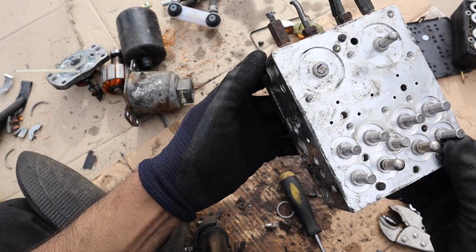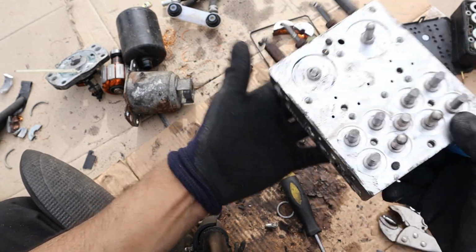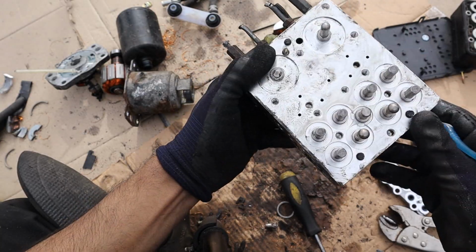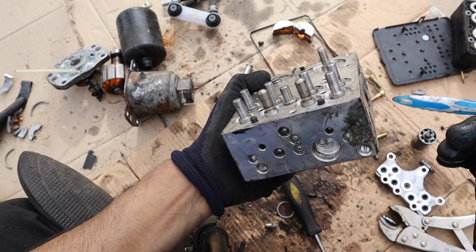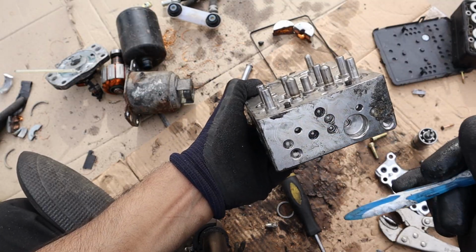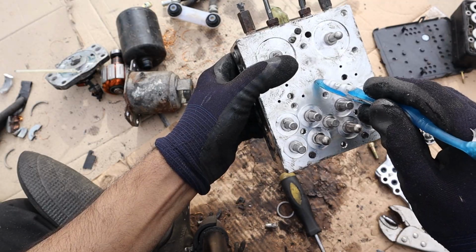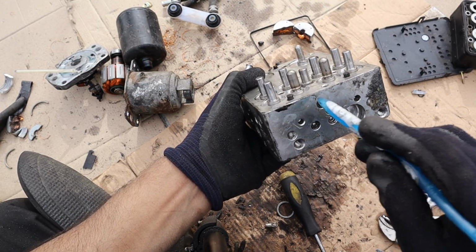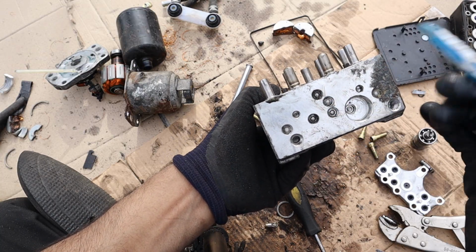Now one thing that always amazes me, especially with engine blocks and lubrication circuits, and even this part here itself, is how do they take just a big chunk of aluminum and turn it into something so useful? How was it actually manufactured? Now if you really look closely, you could see that they've got little holes here where they've drilled to make little oil galleys in here. So for example, if you wanted to make an oil galley running down this way, if you follow the line down here, you'll see that there's a hole here that corresponds to a galley that would have been drilled here, and they've pressed in these little steel balls.